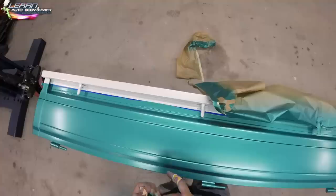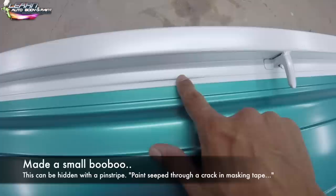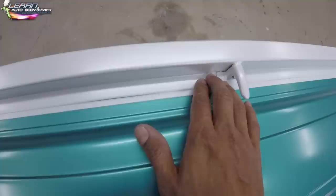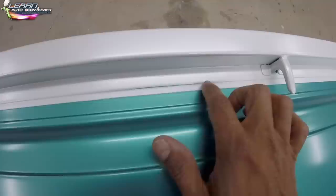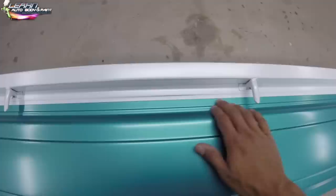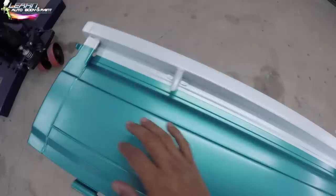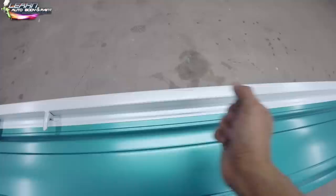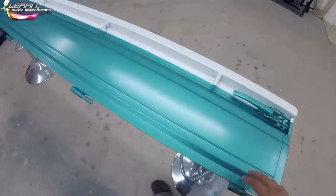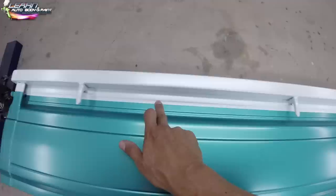This is the fine line tape I'm talking about, used to mask and create the line here. We did the same thing on the tailgate and we have some light overspray going through the tape line — you can see that green. I'm not happy about it. I did try to wipe it out but you can still see it in the groove. You could try to sand it, but the best way would be to mask it and dust the base again. Because it's a two-tone with a white base and moon dust white pearl on top, it's a pain.